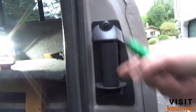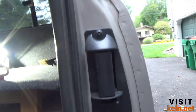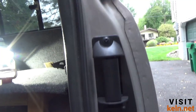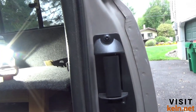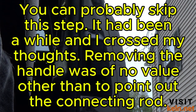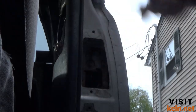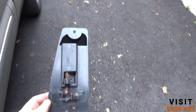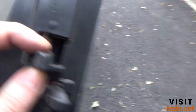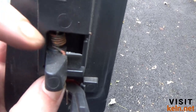All we have to do is back these two bolts out and then we'll have more room to slide our hand down and get to that other post. Hopefully if you're lucky it's just the top one, because the top one's easier to get to, but mine's not. All right, not great but not horrible. That's our driver door latch — common for these trucks.